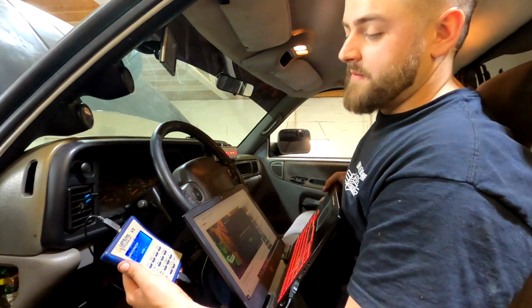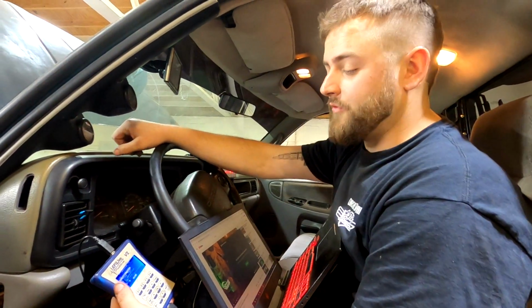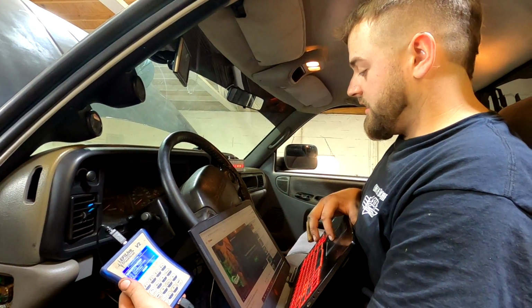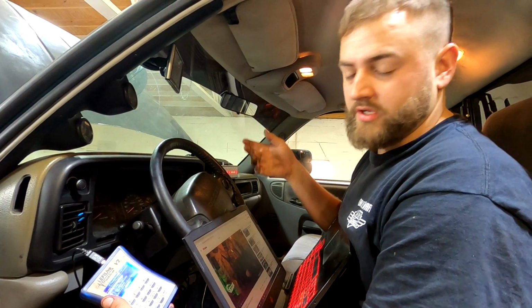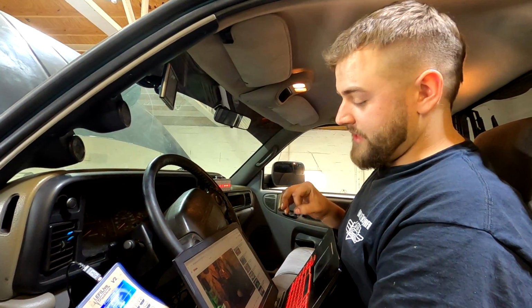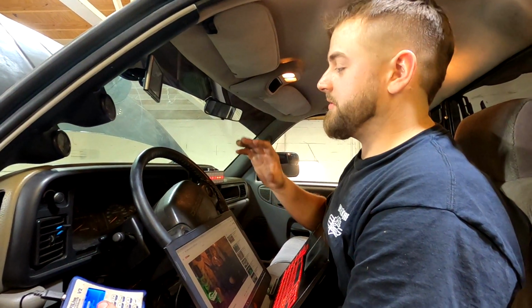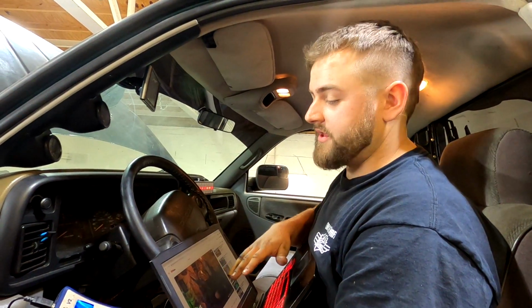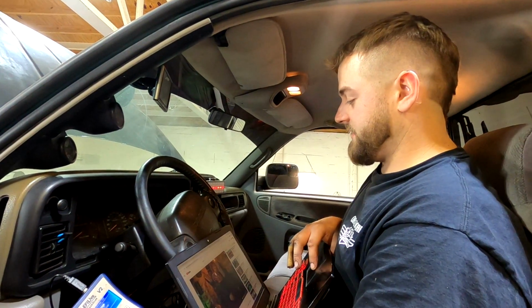What I'm about to do now is my buddy Ryan Milliken over at Hardway Performance sent us some tuning for this engine to make it standalone where it doesn't look for a Dodge truck, because we've got a standalone computer in it. So that's what we've got going on. I'm going to flash a file into it. All it's going to do is idle and free rev, and we'll be able to do literally anything else till Monday when we can get on here and do a data log with him and with our EFI Live V2. And he can tune it how he sees fit. So what I'm going to do now is flash the truck.